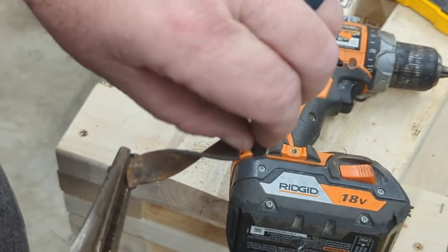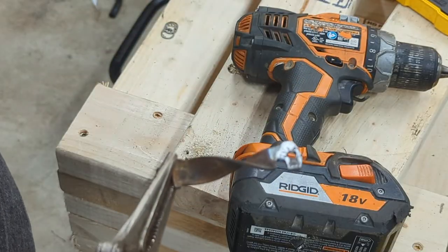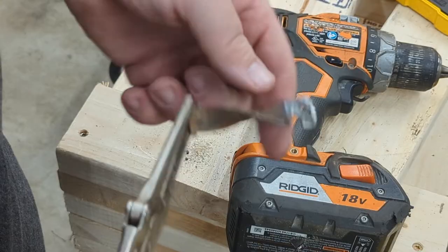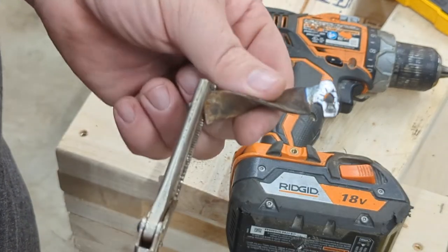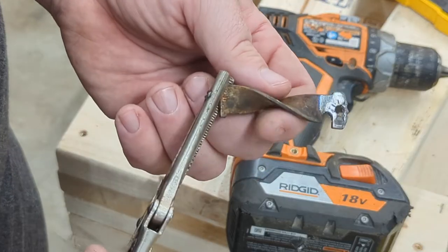That actually is the one that holds the screw that holds the throttle on the handle, holds it all together. So I think the one that's going through the cable should fit through that. So I'm going to sand this down just a little bit, and we'll put a little lube on it when we put it together. It's a little WD-40.